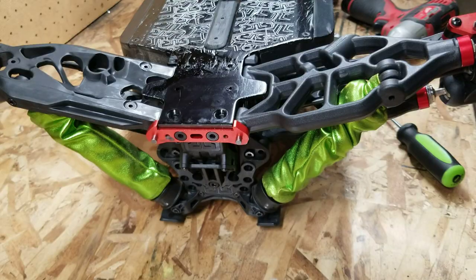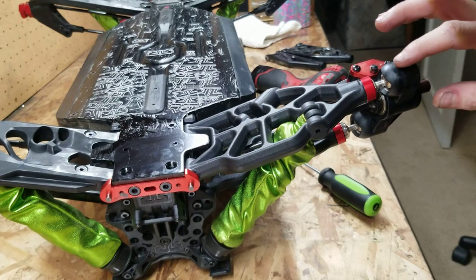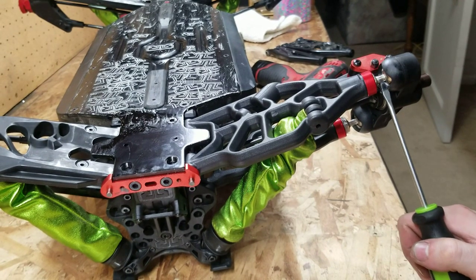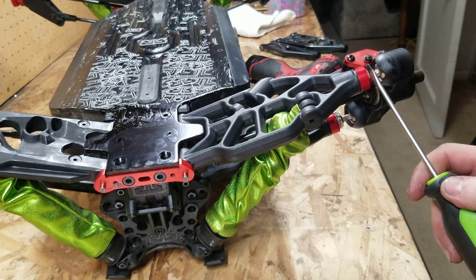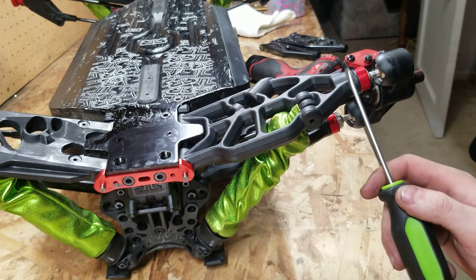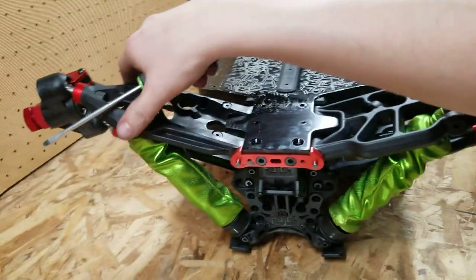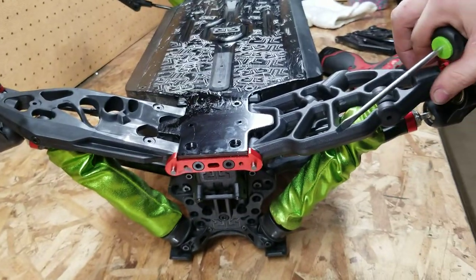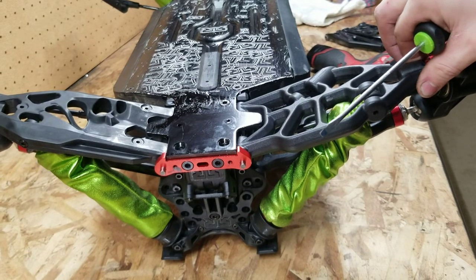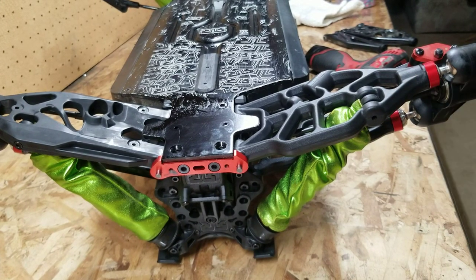I used the drill to bring in these hollow balls — these are the steel hollow balls. I used a little bit of 50,000-weight differential fluid on the threads to make it easier. So far the slop is gone in the front end — the wiggle is gone. Look at the factory wiggle versus this one — it literally moves the vehicle. These fit the tire much better which will actually help steering.